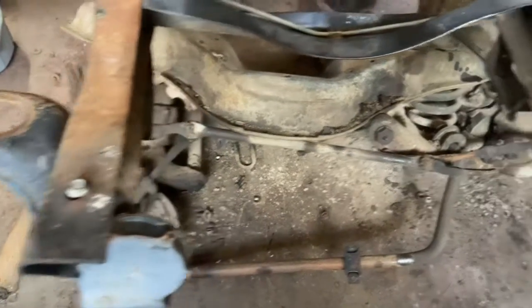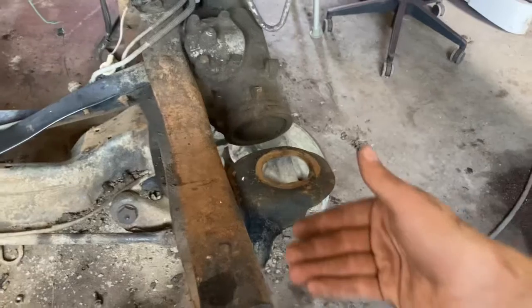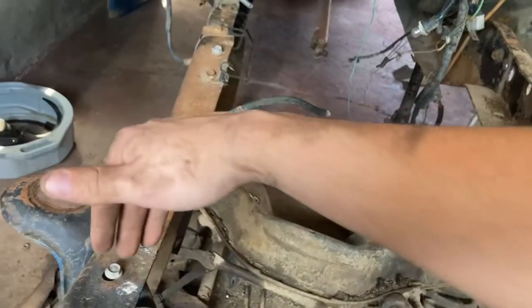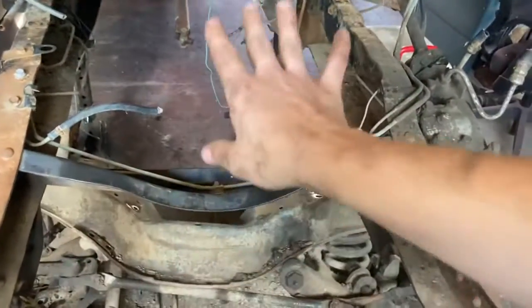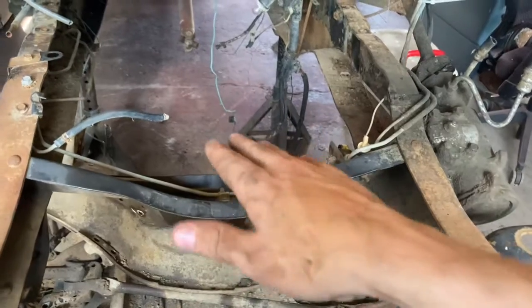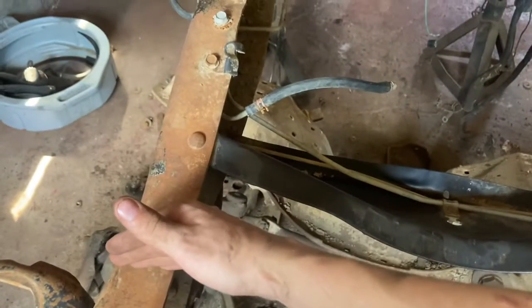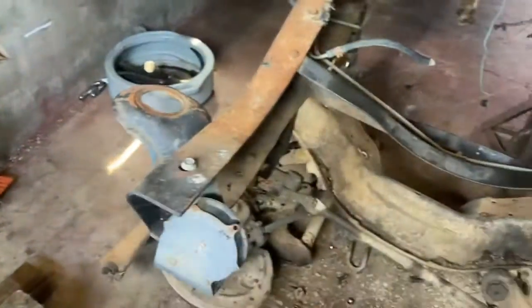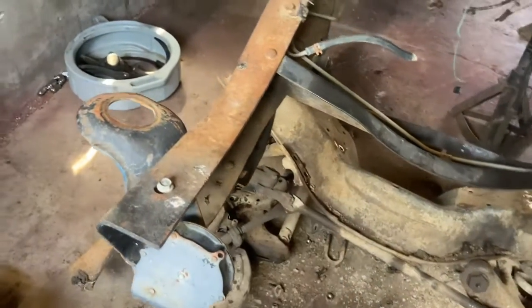I think I'll have to measure in here. Maybe I'll get a cardboard template of this side and then lay it on the other side to see exactly where it bends. Once this thing's rollable again, I'll have the leaf springs under it. I'll pull it outside and wherever it bends — let's say it's tweaked here — I'll make a cross member right there, hook up a chain and a truck, and pull it that way. Hopefully it'll tweak it in enough.